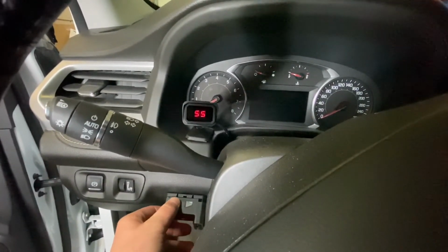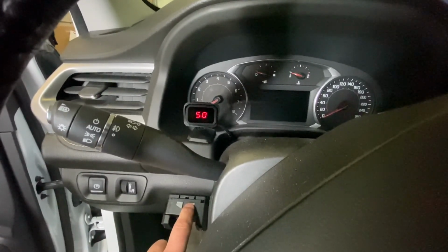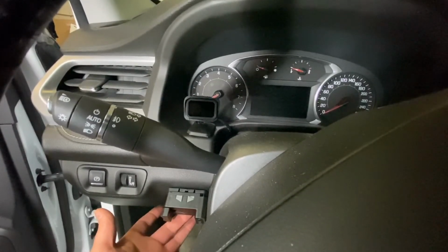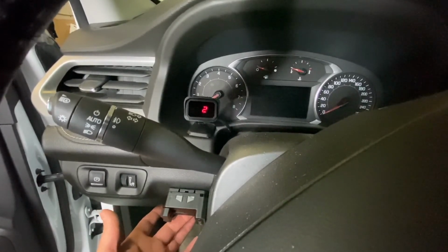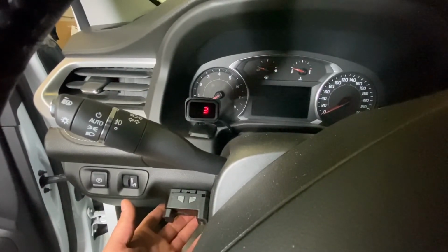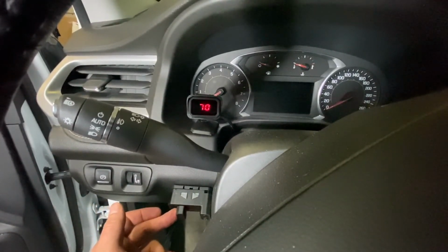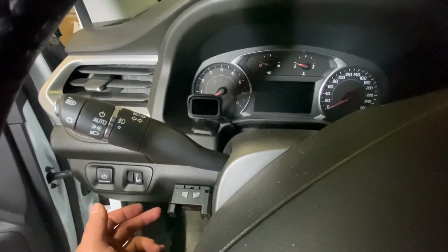On the very top here, I can click the negative left and positive right, and that will change my power settings on this controller. On the bottom here, in this particular orientation, I have an S, and that is the sensitivity of the controller. It goes all the way 1 through 7 and repeats. Depending on your trailer application, you're going to have this set to a certain level. And then this here, once again, is your manual power override. I can simply slide it across, and you can see it will go all the way up to 99% on the scale here.